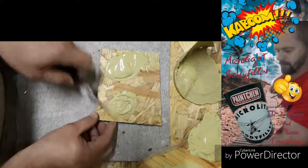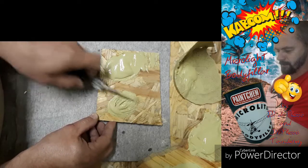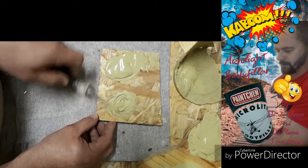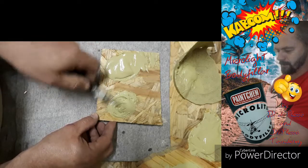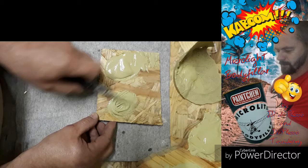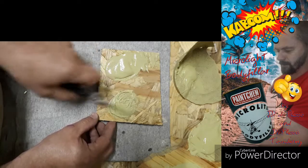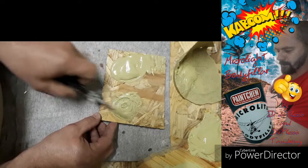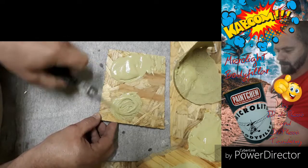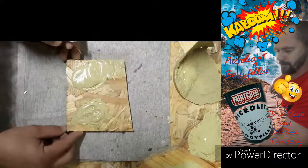On the right hand side, when I've poured 9 drops, you have about 2 to 5 minutes play time on it. Sometimes, depending on the heat temperature outside, it's 2 minutes straight, but other than that, you just reduce your drops. Don't go to 2 drops or 3 drops, rather use between 5 to 10 drops. Okay, so I've mixed that now.